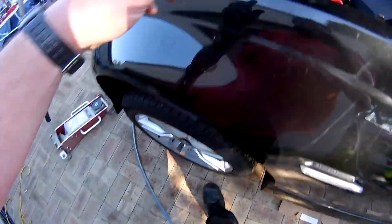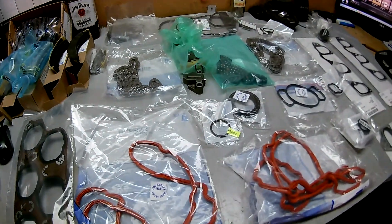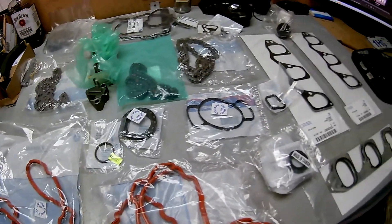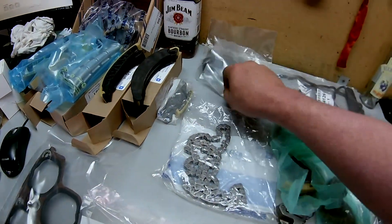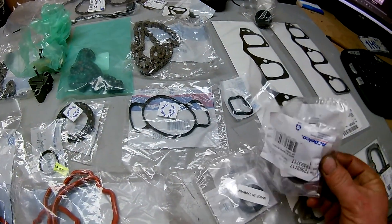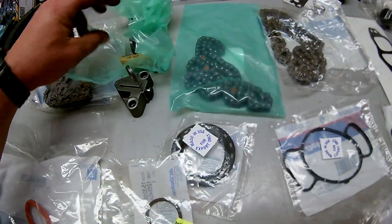It's not pretty, but moving forwards we've got our kit out — genuine GM timing chain kit. Now this is a $780 kit. It absolutely comes with everything except for the Commodore itself. There are four lots of rocker cover gaskets to suit VE and VZ as well, two lots of plenum gaskets, front seals, water jacket seals, back of the water pump seal, and obviously the main thing: the chains. They're pretty good quality.